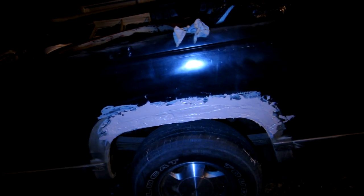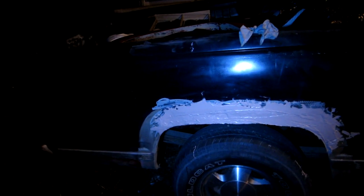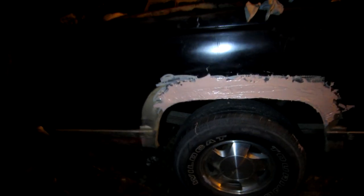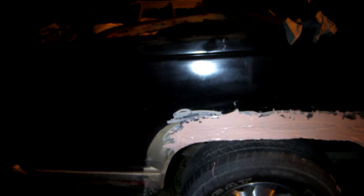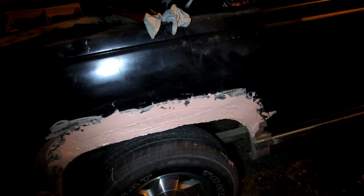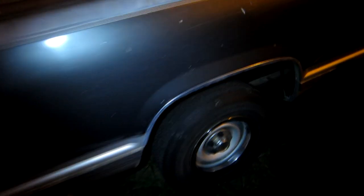I just wanted to show the progress of getting it dried in, at least to where I don't have to worry about it rusting again. I'll come out tomorrow and put a good sanding on it and then hit it with primer. I don't think it's gonna rust overnight. I've still got to shape a lip — like the lip around the edge of the wheel well — I've got to shape that into it.